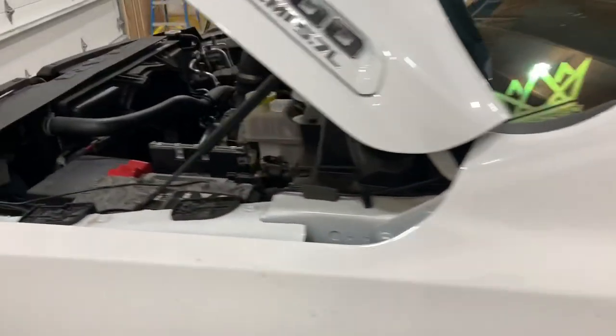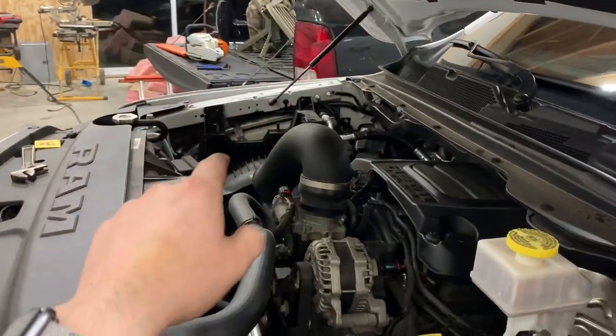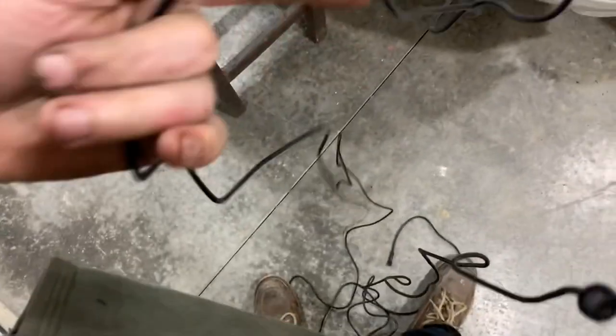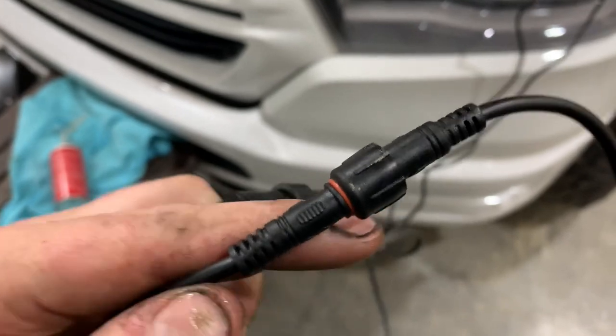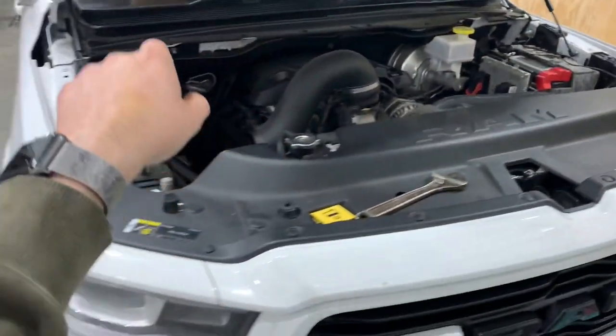Making a little progress — I just got the lights mounted on the driver's side front fender liner. I did have to drop this liner; same process as the rear. With the battery tray there's not as much room here, so it was easier to pull this liner out. I was adding extension wires when I noticed something: the connection on my left is done correctly, but this one I have to undo and reseat the O-ring. If that O-ring is not seated correctly it'll allow water and moisture to get inside, so make sure you check that.